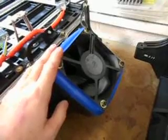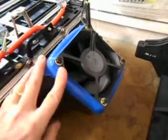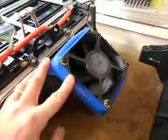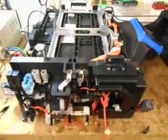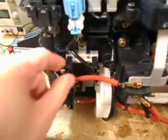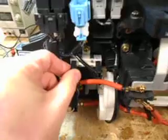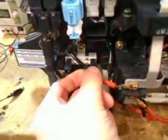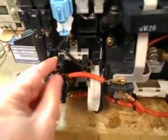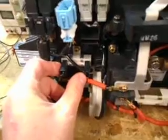The fan is controlled by a couple of relays. One allows uninterrupted power through to the fan — that's the high speed setting, running the fan at full power. The second runs through a resistor — that's the low speed setting. If you want to increase the cooling effect even when the car is commanding low speed, you need to take this resistor out of the equation. Disconnect the two plugs and connect them together, so that whenever the fan is operating at all, in either low or high mode, it will always be operating at maximum speed.